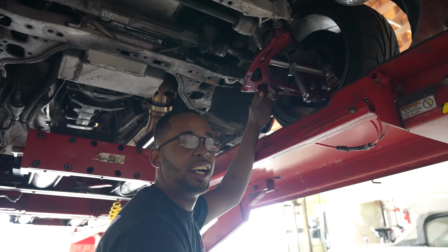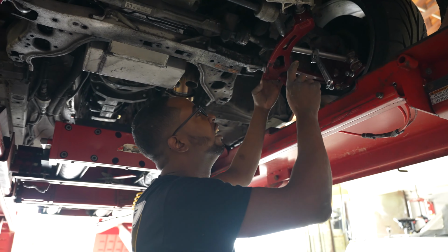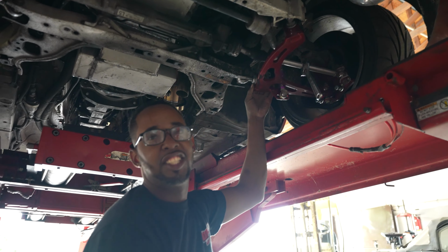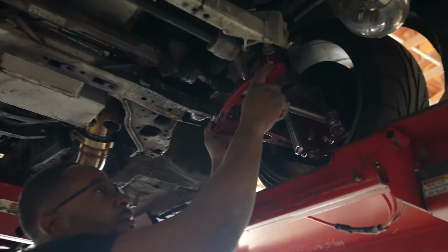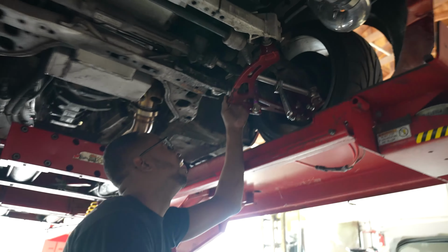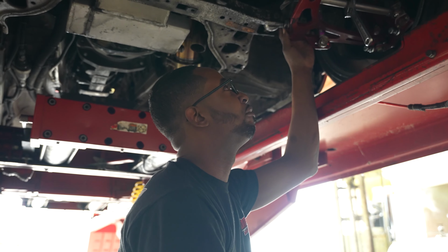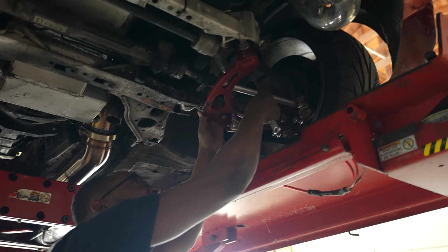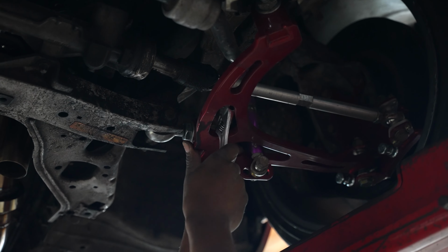This is the updated FDF kit. It looks like it's lighter weight, and they put these adjuster things on, so you don't have to take the arm off anymore to adjust caster or some camber. You can do it on the car. So that is a big improvement. I'm really liking that. And real handy, you can reach right through and get to the tie rod. I think that was good.